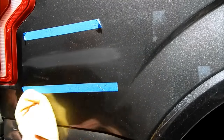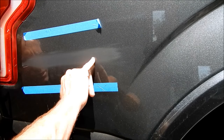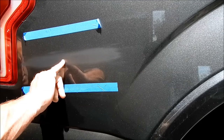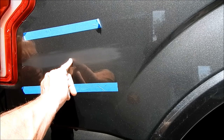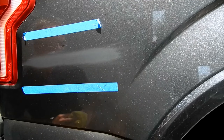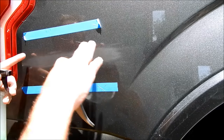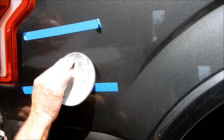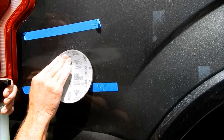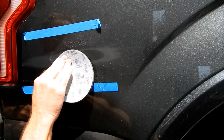I'm wiping and double-checking with my readers, looking for any discernible scratch remaining. Even with the readers on you really have to look closely right through here. Once I polish, it will actually enhance any scratch that hasn't been 100% removed — because you've created such a perfected canvas that any blemish will truly reveal itself. That's actually a disclaimer I give customers when doing paint correction.